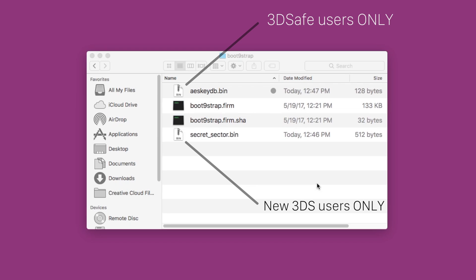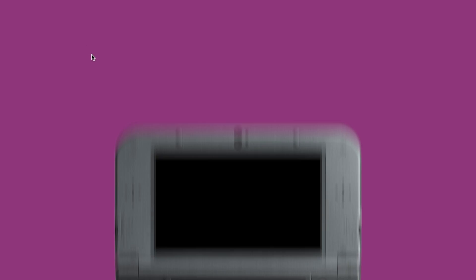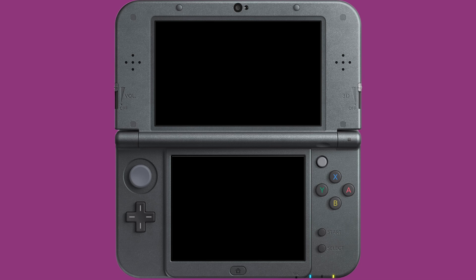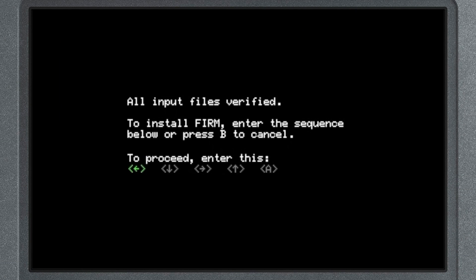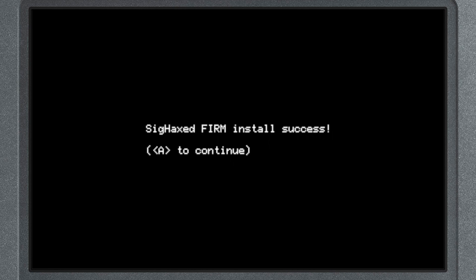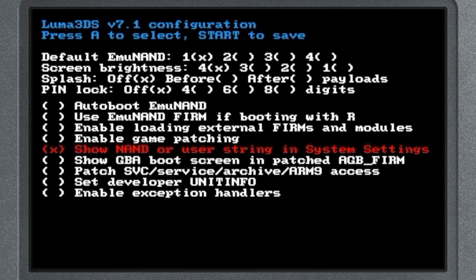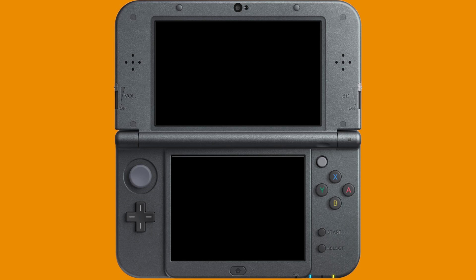Once you have all the files on your SD card, go ahead and eject it from your computer and put it into your Nintendo 3DS. Power on your Nintendo 3DS while holding Start to launch the Safe B9S installer. On the bottom screen, you'll watch it go down the line until it gets to the Firm Backup, and it'll ask you to enter the key combo on the top screen. Go ahead and enter that key combo so it does the Firm Backup, and once it's done it'll say 'SigHaxed Firm Install Success, press A to continue.' Press A and it'll take you to the Luma 3DS menu, where you want to scroll down to 'Show NAND or user string in system settings,' press A, and then Start to save, which will reboot your Nintendo 3DS to the home menu.